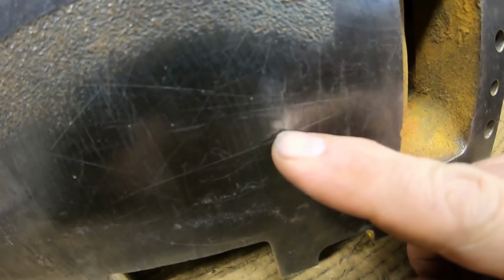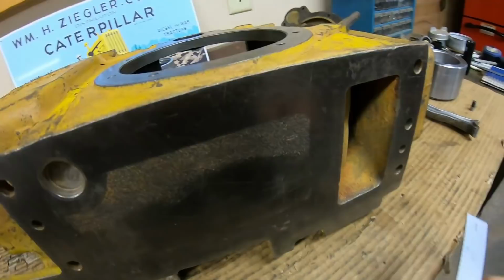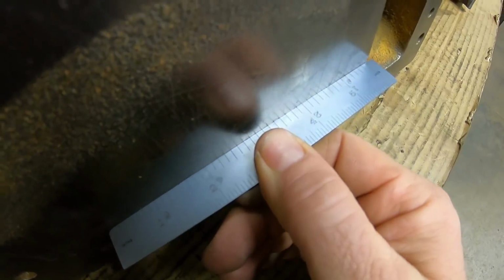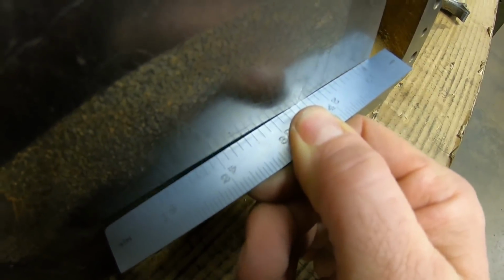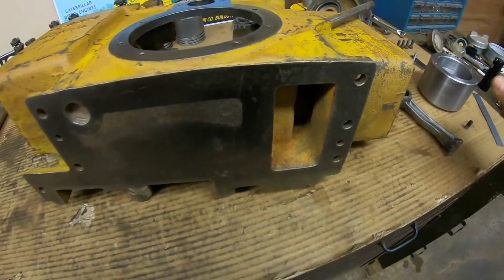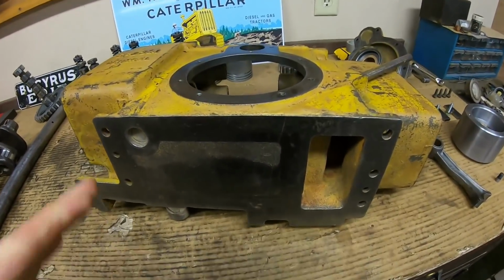You can see the cracking and stuff. It's kind of almost spider webbing out from there. Yeah, it pounded that down pretty good. So you can check it with the straight edge of this rule. See, we're nice and flat there, but we get on that crack spot. You can see how far that actually pushed through, but that's inconsequential because of the base gasket on these.